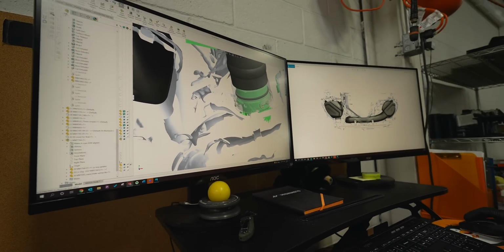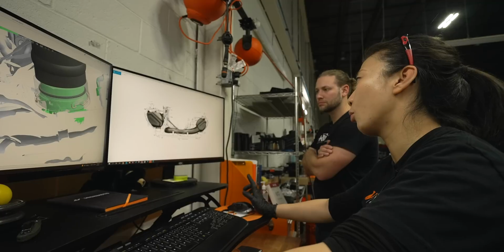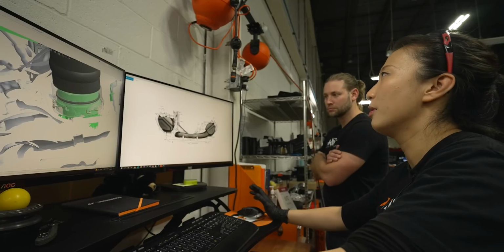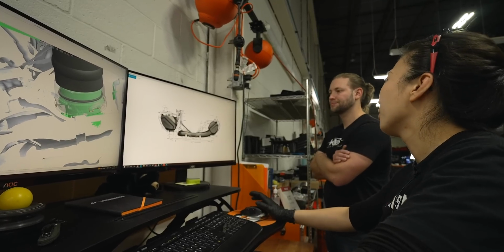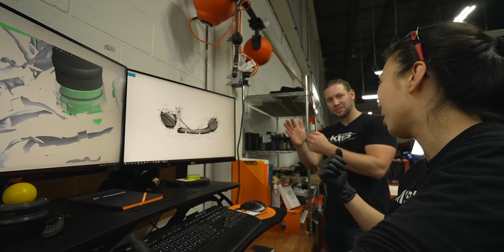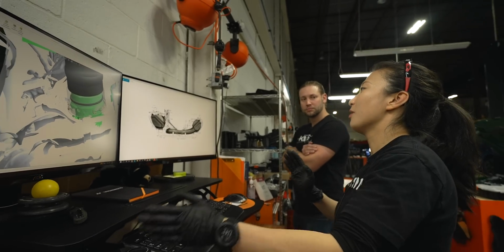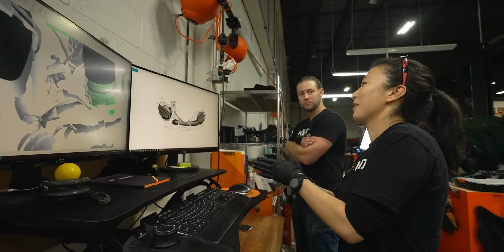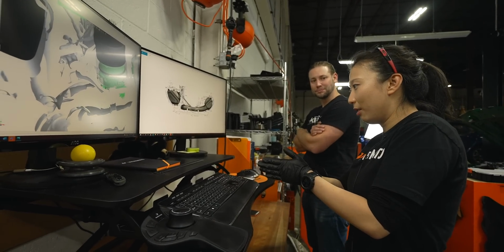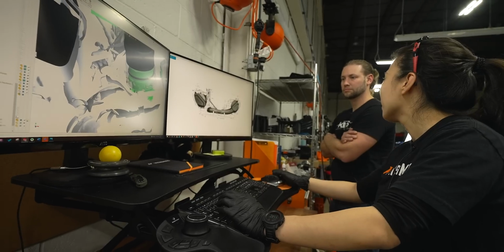This is definitely one. The Supra is also pretty complicated. I would say the Supra airbox by itself, it's only 1 intake versus 2. The Supra airbox is even more complicated because we have to integrate a heat shield. I don't know if you saw the stock intake on the Supra. This car has that piece of metal on the side of it. That exhaust manifold heat shield is normally on the engine, but on the Supra that piece is bolted to the airbox. We have to either retain it or make our own. So we chose to make our own. Our airbox comes with 2 pieces of heat shield on it.